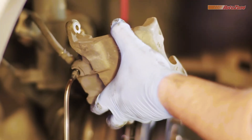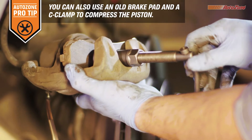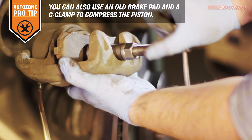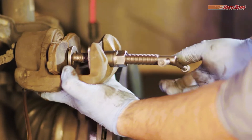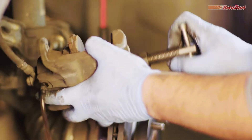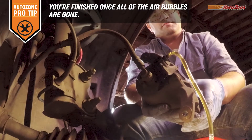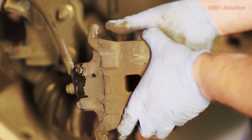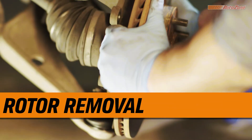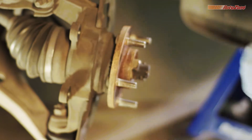A caliper compression tool and an old brake pad will make life easier and help protect against damaging the caliper. You can borrow one from AutoZone, saving you from buying one or asking the neighbor for theirs. Use the caliper compression tool to compress the piston until it stops. Hold the caliper with the bleeder valve up to prevent air from getting in, and wait until all of the air bubbles have come out. Now tighten the bleeder valve. The rotor is then removed — if it's stuck, some brake cleaner and a couple hits with your dead blow hammer should do the trick. And just like that, you're halfway home to replacing your front brakes.